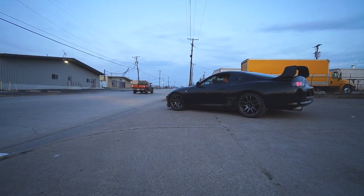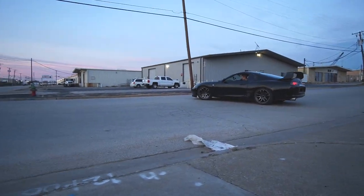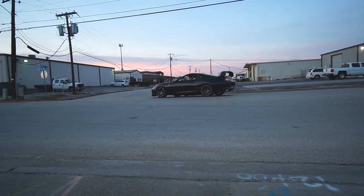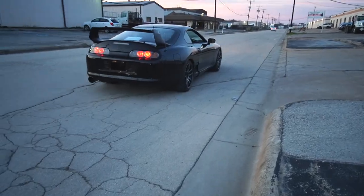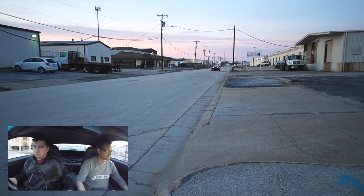So this process, just drive slowly and see what happens. Oh, she did. Can you rev now without it trying to cut you? Kind of cuts. There. Okay, let's see if we can drive it. All looks good. We're rich. This is really good. Rich, okay. Good, good. Maybe the throttle setting needs to be, we need to calibrate the TPS here in a second, I think.